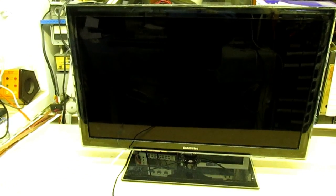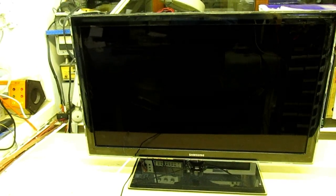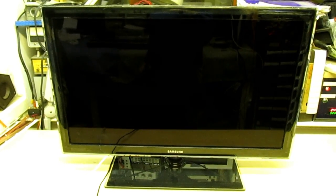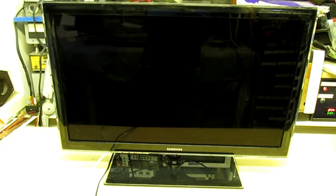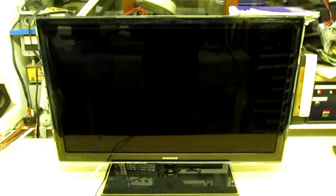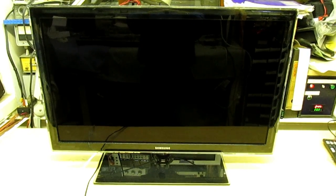Hi guys, a very quick video here. I've got a Samsung TV, a UE32D5520. Now this series of TVs suffers from a very common problem. It's software corruption in the NAND IC. And what you have to do is take the NAND IC and reprogram it. Now I'm going to show you in this video a simpler way of reprogramming the NAND IC.